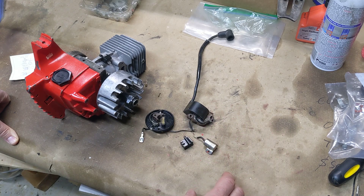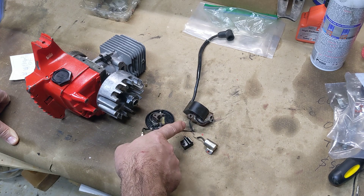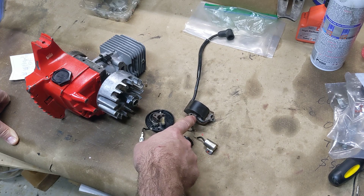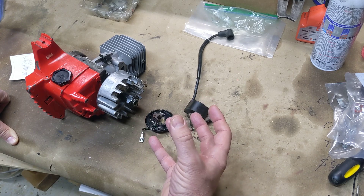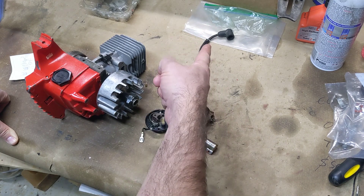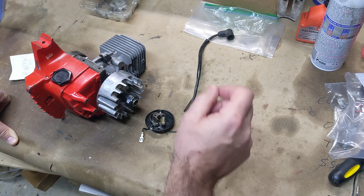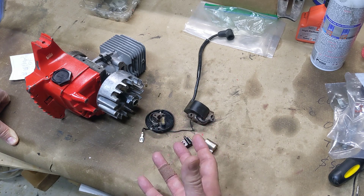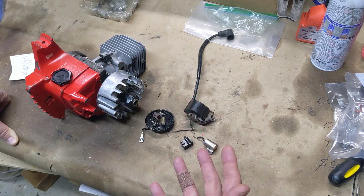It's an ignition coil in how we're using it. What happens is in a transformer, when you power up the primary coil, it creates a magnetic field in this iron core. And when you collapse that magnetic field by disconnecting the power source, that energy's got to go somewhere. So it goes out of your secondary coil, which in this case is a spark plug wire with a spark plug and a gap. That gap's got to be small enough so that the power can jump that arc to try to get to ground. That's essentially how it works, and that's why it's called an induction coil — taking electricity and magnetism from the primary coil and inducing it into the secondary coil.